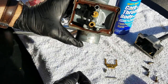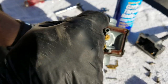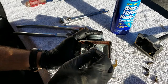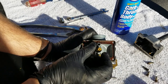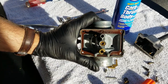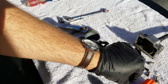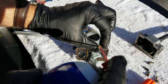You have all these ports, and what I'm concerned about is that over the summer gas was in there clogging the ability for fuel to flow through these. So I'm going to take some of them apart. The first one is this one — pretty easy to remove, and it's got a washer. You can probably see the hole clear all the way through. So that's free and clear, but I'm going to give it a shot of carb cleaner to make sure it's good and clean and that hole through there is free and clear.